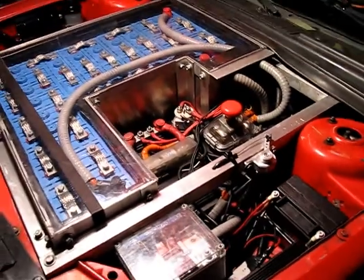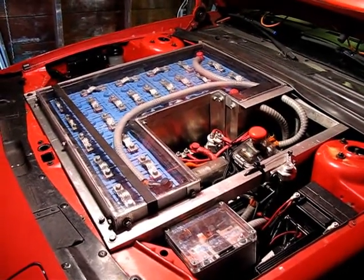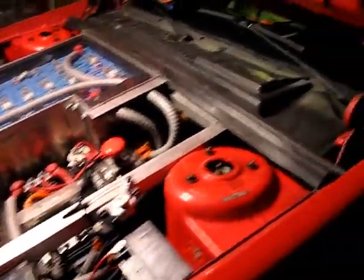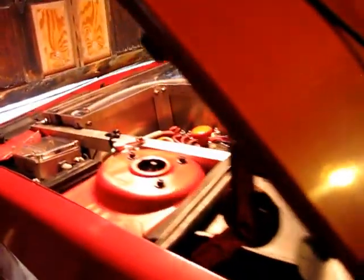As you can tell, you can actually hear me talking over these things because they don't have fans that are loud and obnoxious like the good old Vicor. So I installed them, was happy that they were silent, and then we went and did some testing. We'll turn on the ignition. So it's just the ignition, which is the Soliton and the router, the Linksys router. And from our little display here, you can see we're putting out a nice solid amount of power. We could put a multimeter on it to see, but it's 13.9, give or take, seems to be what these guys are putting out.